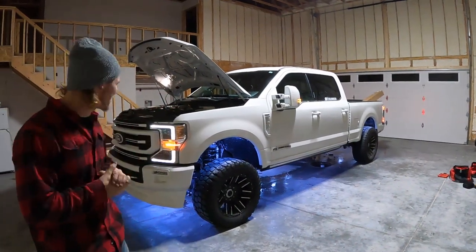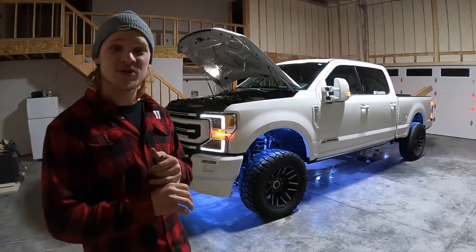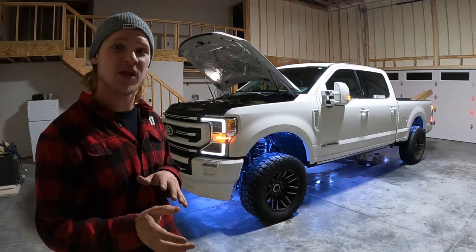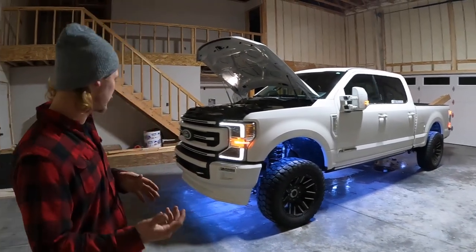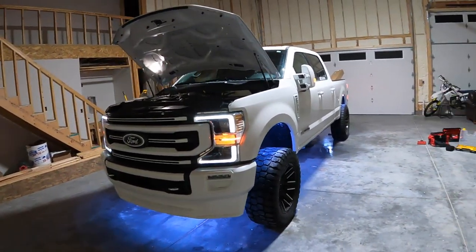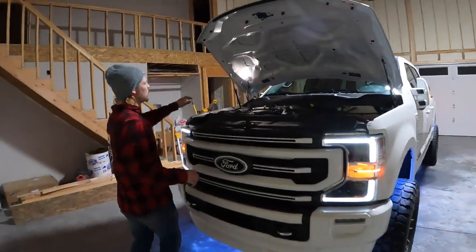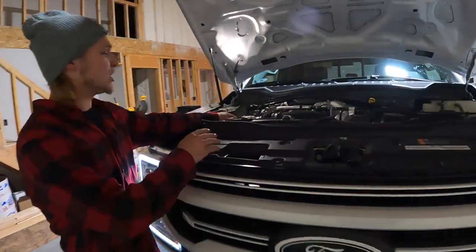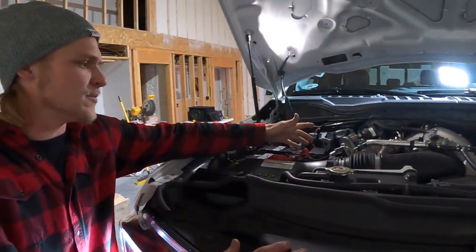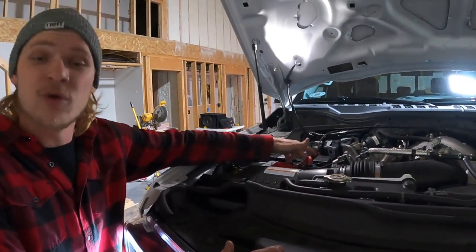We just finished up the install and I could not be more happy with how this thing turned out. We ended up using 30 of the 32 rock lights — I haven't decided where to put the other two. We have full light all the way from the front to the back and to the receiver hitch. Like I said, we cut out that relay. You can go just black and red wire straight from your fuse box. Make sure you're going off of auxiliary switch five or six to ensure it is a 40-amp relay.